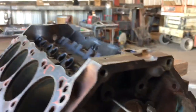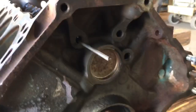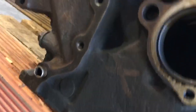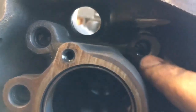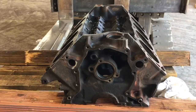I'm taking the plugs out of the back of the motor here. It's pretty loose. We got all three out and the reason I'm doing that is so I can clean out these oil passages. I already got this one cleaned out. This is a piece of filler rod. I used it to knock out this front plug. Sorry about being so jumbled around. I knocked this one out and I'm going to knock these two out to help me get the block and those passages blasted out a little better.